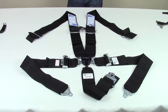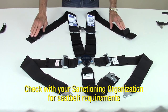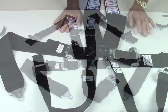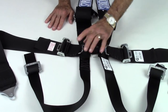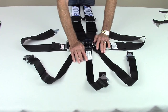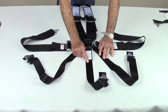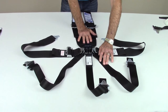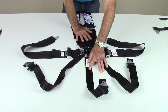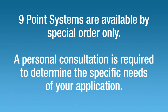5-point seat belts are by far the most popular. However, many sanctioning bodies are beginning to require 6- and 7-point designs. Quite simply, the more extreme the racing environment in terms of speed and track conditions, the more straps. 6-point systems provide more restraint in the lap area to keep the driver firmly positioned in the seat. Additionally, a 7-point seat belt adds to the integrity of the restraint by adding additional support to the lap area and assuring the positioning and effectiveness of the shoulder harness. 7-point systems are very popular with Bonneville type land speed vehicles. We do have 9-point systems, which adds an additional shoulder strap. These systems are special order and require consultation to meet the needs of your application.